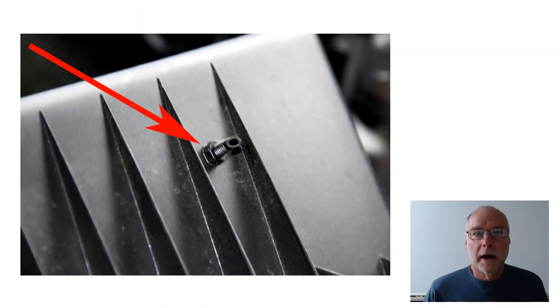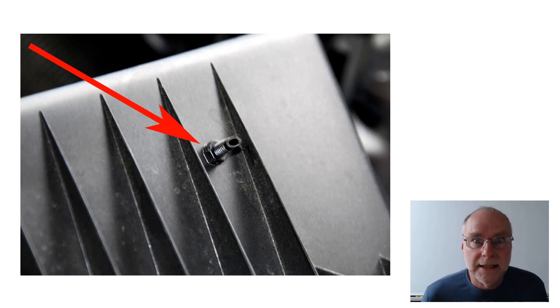We're going to start off by looking at a little pressure tapping point. The way you measure flow restriction is you measure pressure drops through the intake system, which means you need to connect to the intake system. Here's a little plastic irrigation fitting — I've just screwed it into the side of the air box. Drill a tiny hole, screw in a tiny fitting, attach a hose to that fitting that runs to the pressure measuring device. When you're finished testing, you just unscrew it, put a little dab of silicone over it, and you'd never even see it. In some cars there are existing plumbing points you can tap into, but in some cases you will need to add pressure tapping points.